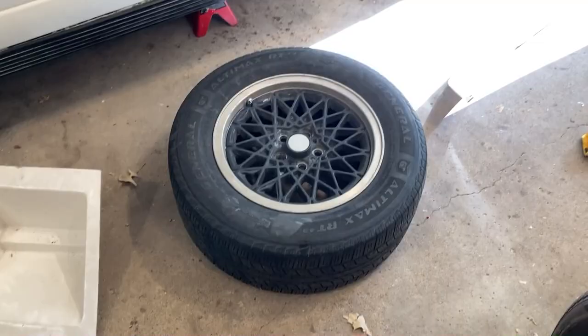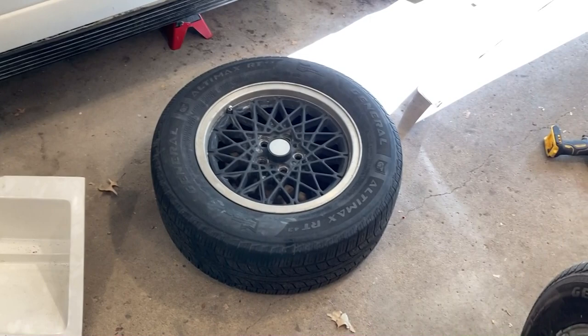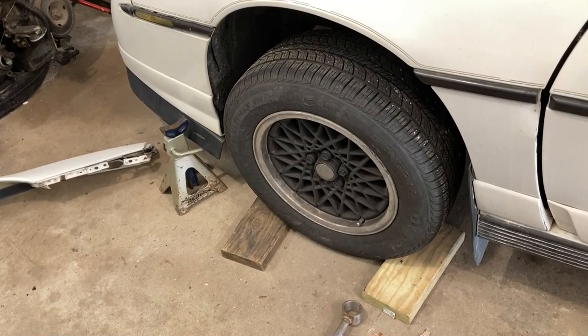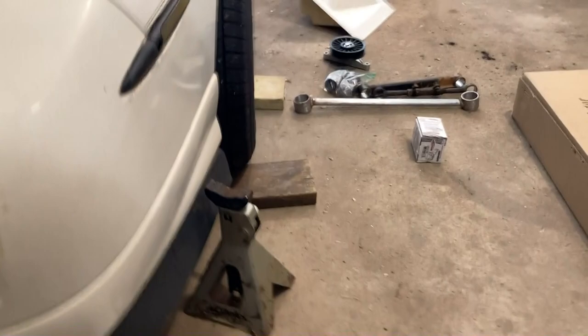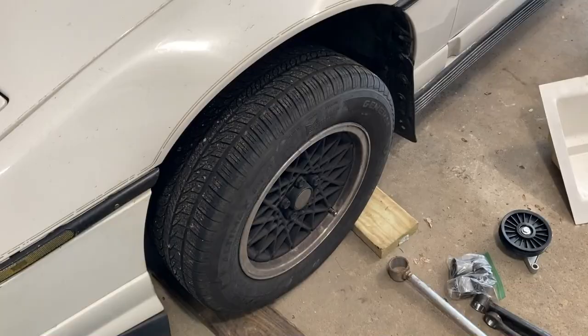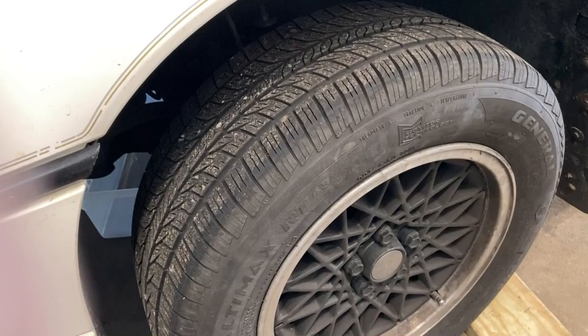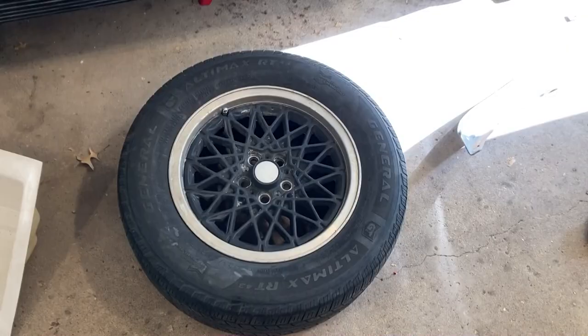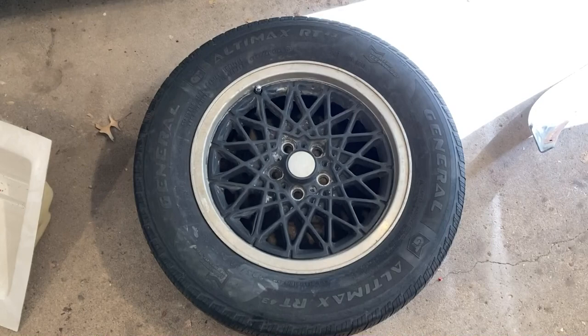Next is wheels and tires. Right now I have four 15x7-inch rims all the way around. The Fiero in '88 came with 15x6-inch rims on the front and 15x7s in the rear. I decided I wanted wider tires a long time ago but I regret it a little as they stick out quite a ways. So I picked up some regular 15x6s to hopefully save some weight and remove rotating mass. I'm also going to get a skinnier front tire — currently running 215s up front when they're supposed to be 205s from the factory, so I'm shooting for around 195s. For the rear I'm going to get some Mickey Thompson 235 R15s, gaining an extra two centimeters of width over factory.